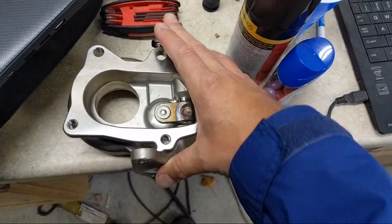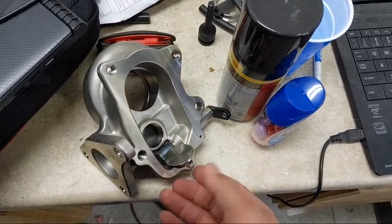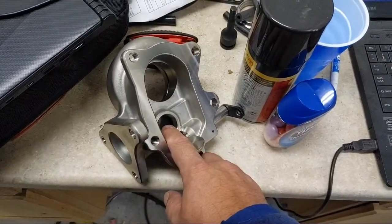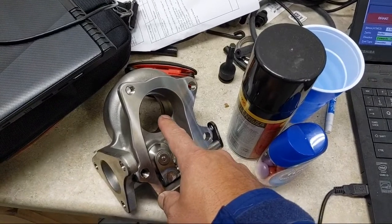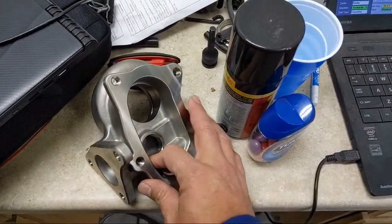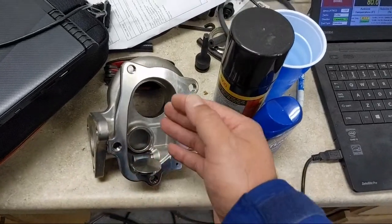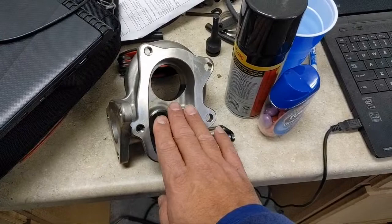There's still more exhaust in the cylinder, causing you to lose horsepower because it takes up space that good clean charge could utilize. And for a Subaru, the fuel injectors are not large enough to handle what a VF puts out airflow-wise when it's creeping. So: high back pressure, excessive turbine speed, inadequate fueling - those result in lean conditions, heat retention, retained exhaust gas, lost power, increased knock chance, and you're hurting your turbocharger by spinning it too much.